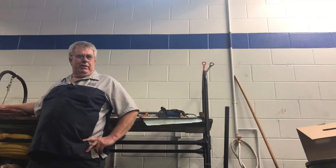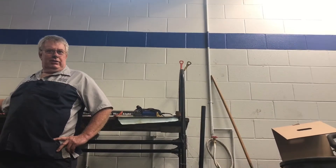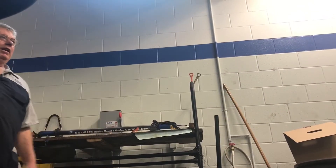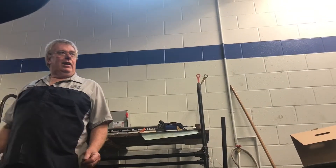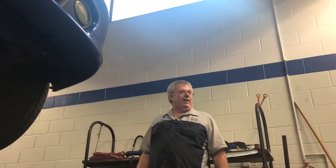Still getting paid to do it - it's not my fault. The vehicle was hit right in that fender and the ECM's right there. It might have had a hairline crack and with the cold shop it lost contact. If you park it back outside and it gets hot it might make contact again and start. Maybe we should have heated it up with a torch first. If it starts, we won't need to buy the ECM - but it's nothing I did. I moved the AC box out of the way but didn't touch the ECM or connect to anything.